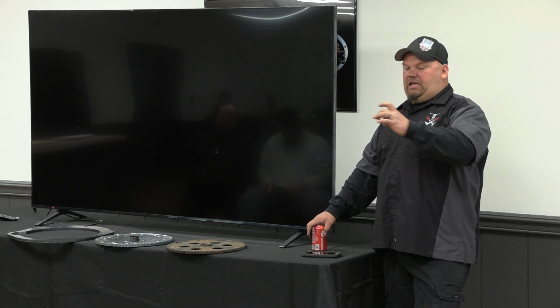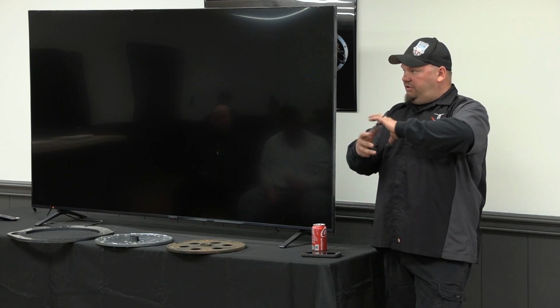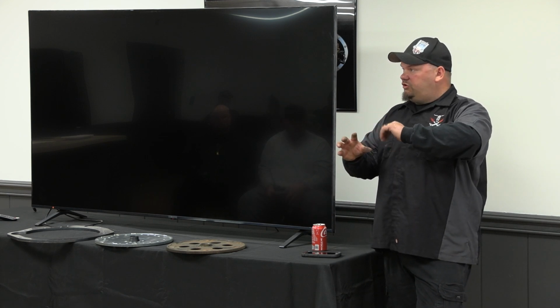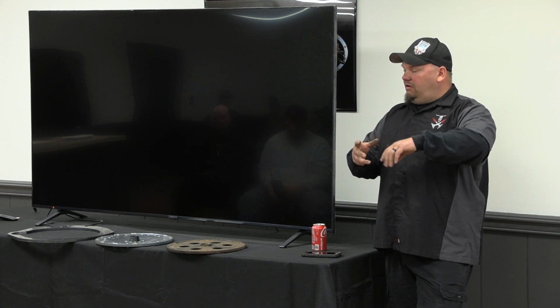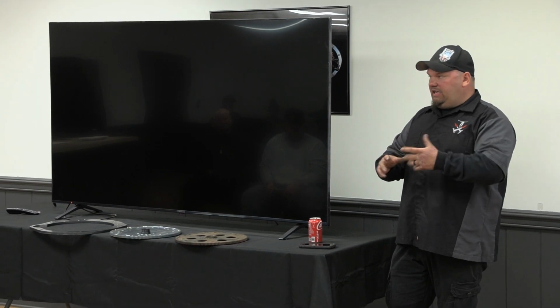So there is a kit where you go in and you bypass that solenoid and it'll give you first gear. You can physically do it. A company called Transgo makes a kit. It's called a 60 mod or something like that. And you buy this kit and it gives you first gear manual. I've got a customer that's trying it behind carbureted setups. You can power one solenoid and it will give you first gear and put it on a switch, turn the power off to it, gives you second gear.